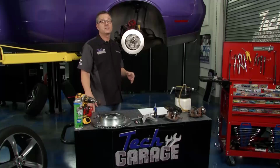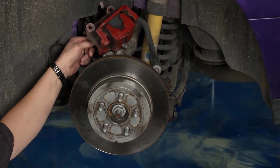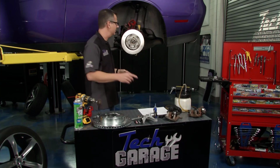Well, it's been traditional up to this point, Brian says, and you know what? It still is. How do I know that? Well, I'm looking at the caliper, and the caliper actually doesn't have a mechanical e-brake built into it. It's just a normal caliper. That tells me we can push it back, but there is something I want to show you.